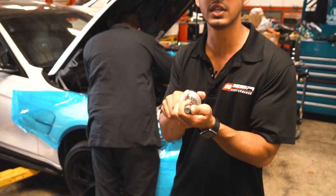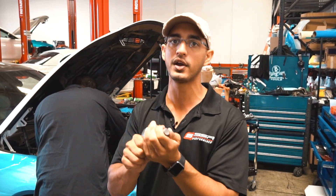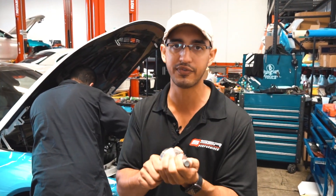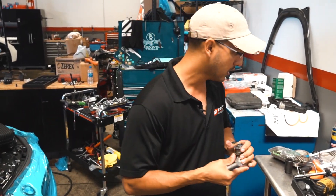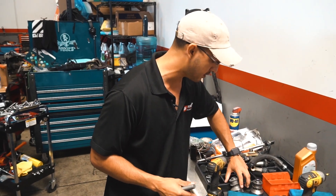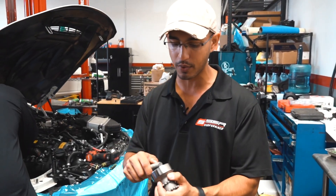You can go back in there and re-time this as much as you want, but if it spun once, chances are it's going to spin again. This is a part that you have to replace — you can't just go in there and fix this issue. A lot of people do it for preventative measures. For example, this M3 behind me is doing it as a preventative measure because he knows he's going to be going stage two and pushing the car with bigger turbos.